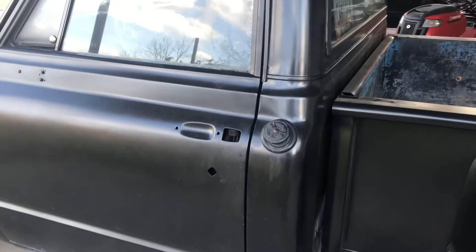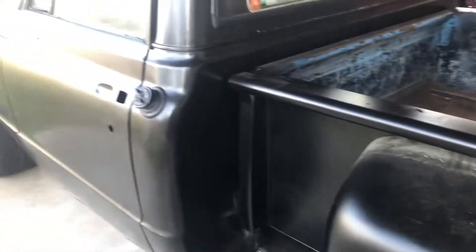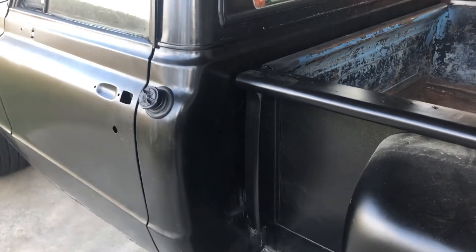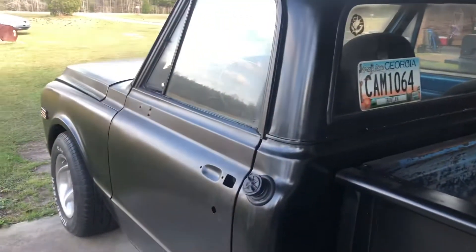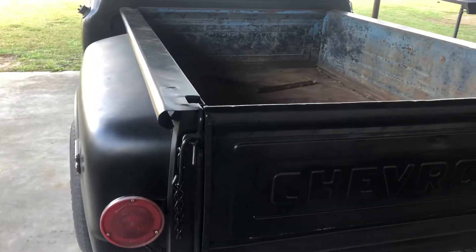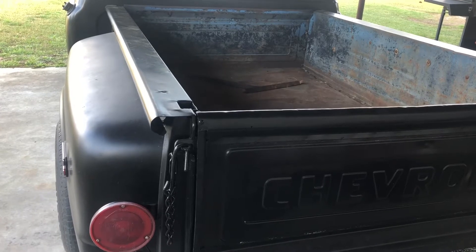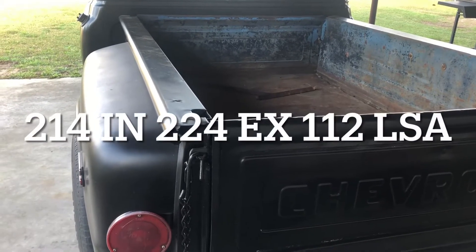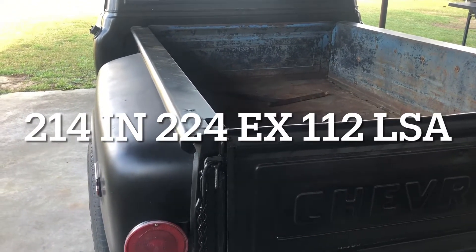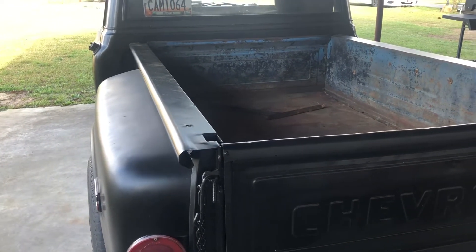Before anybody mentions that little tapping noise from the exhaust — it's kind of rattling down there, it's not the engine, it's not rod knocking or anything. Same plan as the S10 basically, but it's going to be a little street truck, nothing crazy. The cam sounds pretty good for as small as it is. The Summit 1103 is like a 214 intake, 218 exhaust, something like that. It's not a real big cam, but it sounds good, it works good. It's a good running truck as it sits.